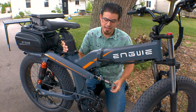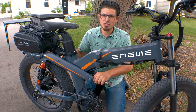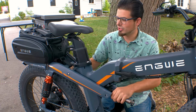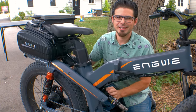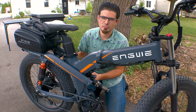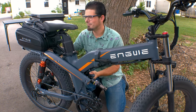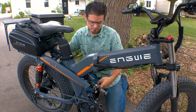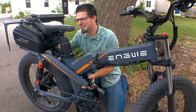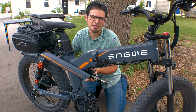And as you can see by the fact that I have it disconnected — not a whole lot. The way the geometry works, it doesn't really actually add much travel. It just kind of tips the angle of the bike a little bit, so it might add some different progression for those rear shocks, but you're really not going to feel that much. Full range of travel from this shock alone is maybe about an inch on the seat, so not really a whole lot.